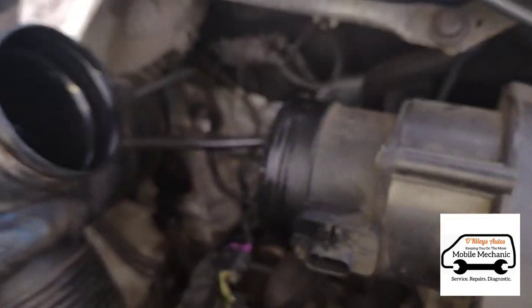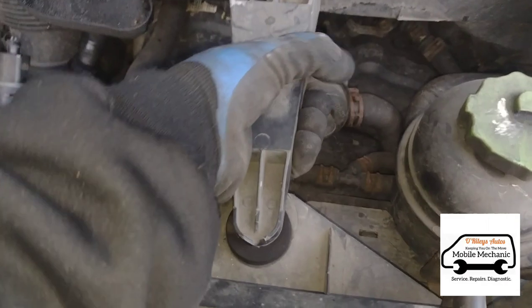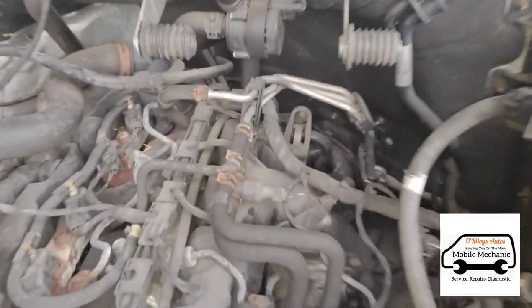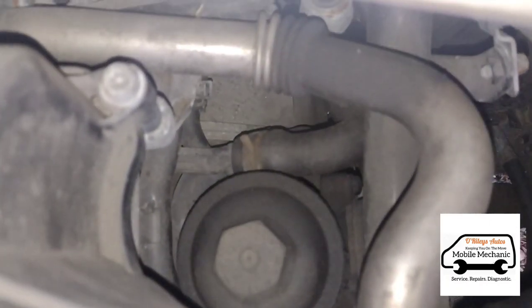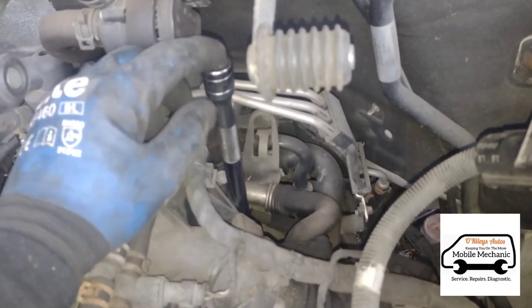Pull the pipe off, then grab either side of these plastic handles and give them a good pull upward. Pull this pipe up — all of this should come out in one piece, just like that. Coming back down to the back end, we have the oil filter — that big plastic nut there. We'll use a 32mm socket on an extension, slide it over, feel where it's going on, and that's it — we're on it.